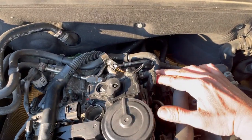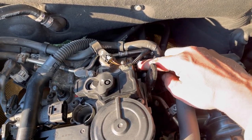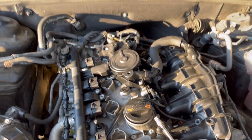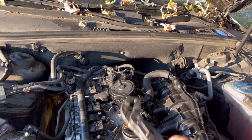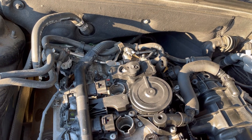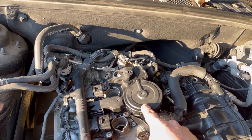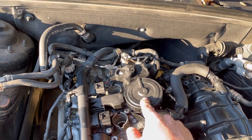We have to get the high pressure fuel pump loose. I'm going to show you the most efficient way of doing this. Someone's already taken this spring clamp off and put a screw clamp there — that's fine — but I've got these spring clamp pliers that won't distort the clip. You can be more prone to oil leaks if you don't keep up with replacing your diaphragm in your PCV oil separator system. This diaphragm should probably be replaced every 50,000 miles.